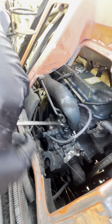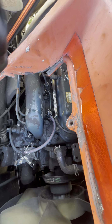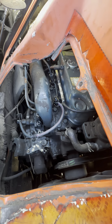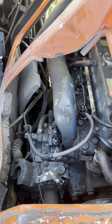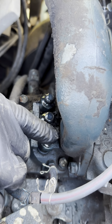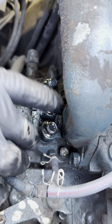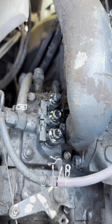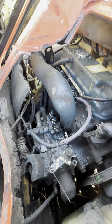According to the dealer, these injectors were replaced because it would not start and would throw a bunch of black smoke. I don't really know the whole history behind this, but looking on top of the injector you can see all that gunk buildup. Take a listen to how this sounds when you try to crank it — it almost sounds like it has no compression, like something is just bogging down the engine. It doesn't sound normal at all, or like a dead battery.